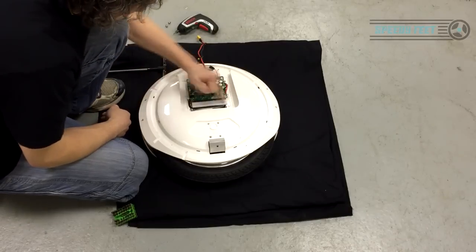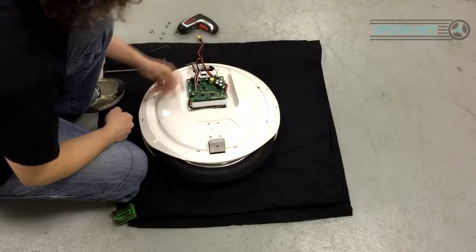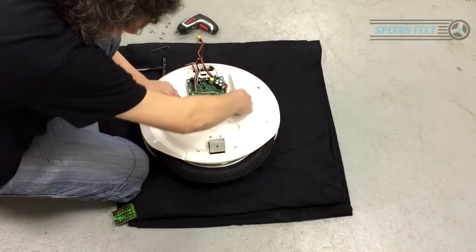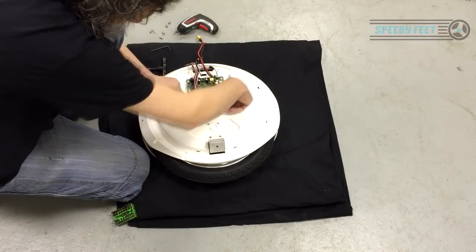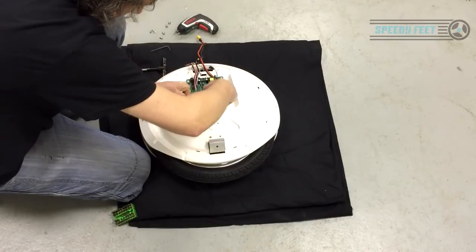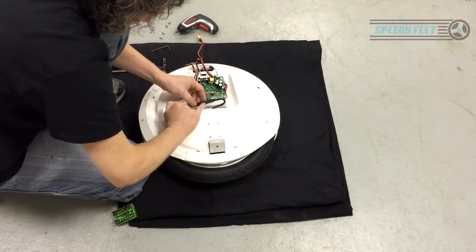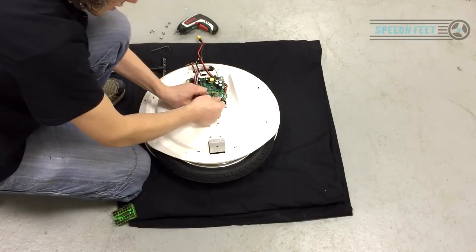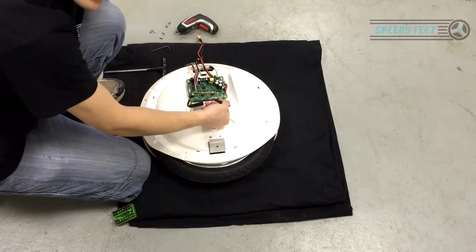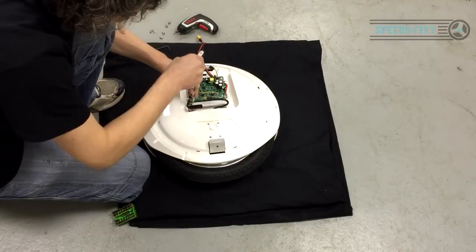Now this is like a heat sink, sat on a plate there. There's a plate underneath there which comes off. This feeds back through into the center of the Ninebot. You just need to push down here to remove this adapter. Don't pull on this part. It is cable tied in. This is the looser part, this side here. Gently take it off. It's got an arrow here and an arrow there. You just unplug it. So wiggle, wiggle, wiggle. And there we go. Careful not to bend the pins. Don't damage the pins. Just being sensible and very, very careful, because it's your investment.